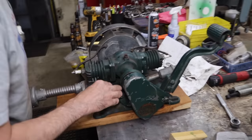Wonder if this might be just like maybe a primer hole. Maybe if I try pouring a little two-cycle mix down there, let's take a look. It feels like it's got compression. See if the plugs are getting wet. No? Let me try shooting a little mix down there. Let me find one of my syringes. Get a container to put some dinosaur cocktail in.